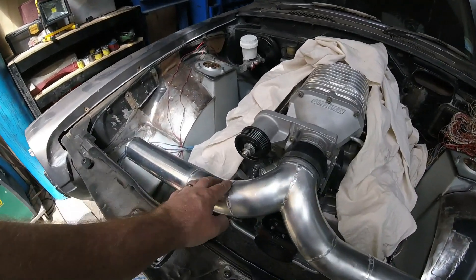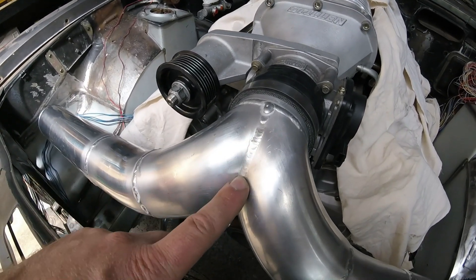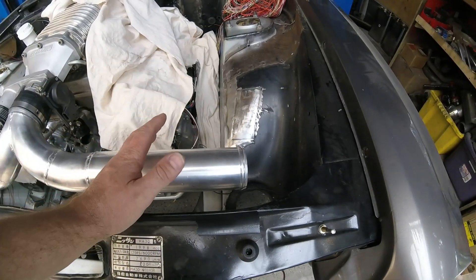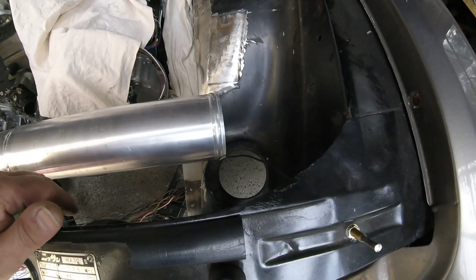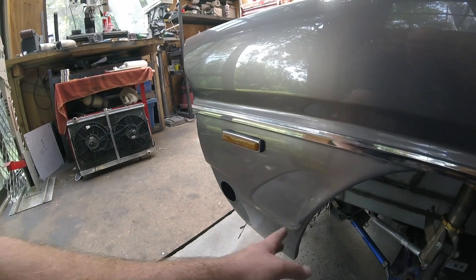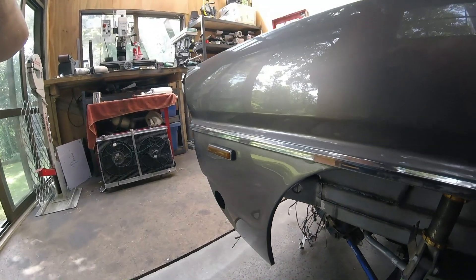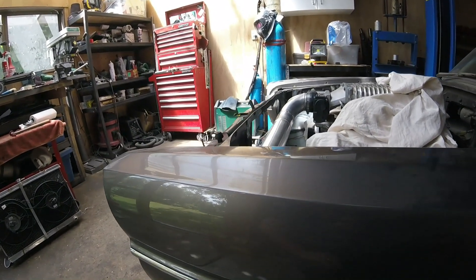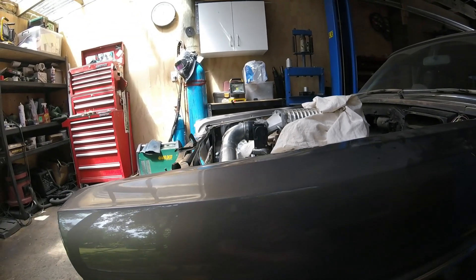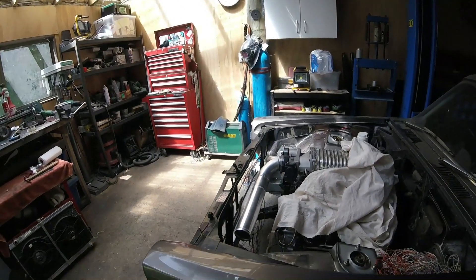I've done that for the customer - he wanted it in a similar style to what we've presented here. This is not quite finished yet; all these welds will need to be ground off and made flush, which is a real shame because I think I did quite a good job - actually quite nice welds - but that's the way it goes. We'll either have an airbox system here on either side, or maybe run an elbow down through that hole you can see there and tuck the filters in behind this panel with a shroud to stop all the dirt and guff. There's heaps of room in there - we can put a big filter in there and just protect it from the dirt, water and dust. From this angle you can see it's quite a low profile for that pipe, so we won't have any issues hitting the bonnet. Not much room between that and the front of the car for a radiator, but we've got to build a custom radiator so I'll figure something out.